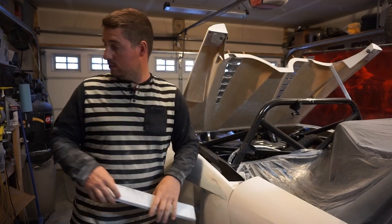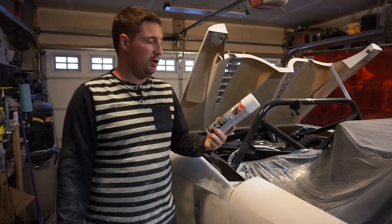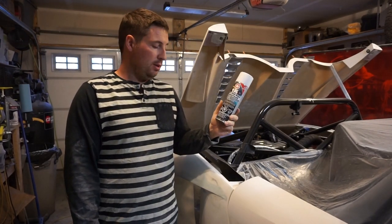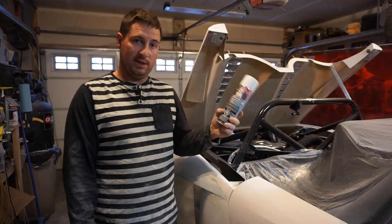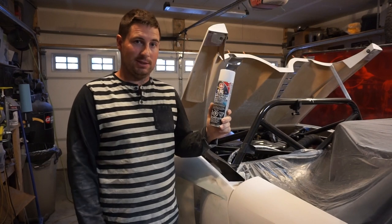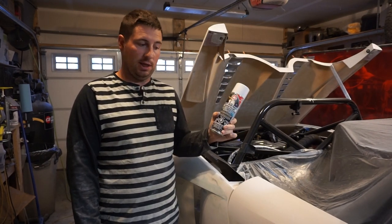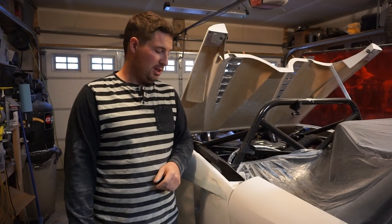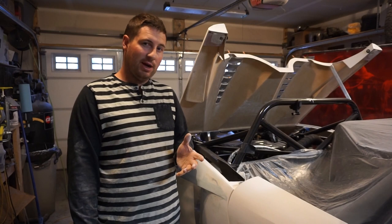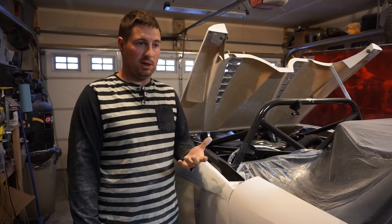So the plan is to next spray everything down with this white high build primer. That'll help fill the sand scratches. And then I'll just rub it all down by hand. I got some 280 grit and that's just how I'm gonna leave the body until I wrap it. It's not perfect. It's not quite paint ready, but I think it's pretty damn close and I'm gonna call it